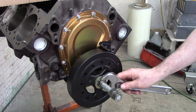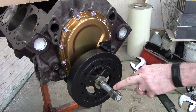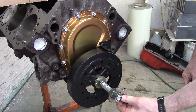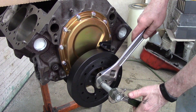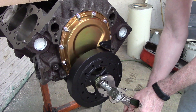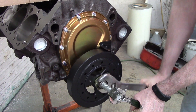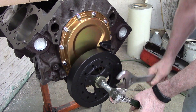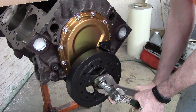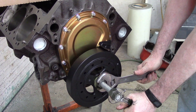That was going on a little harder than I expected, so I did two things: I got a bigger crescent wrench — a 12-inch compared to an 8-inch — and I put a couple of nuts on the back side. I should have welded one on the back end for a holdback, so I'm not turning the engine instead of turning what I'm trying to put together. Now we'll go back to it and finish pushing the harmonic balancer into place. That looks pretty good.